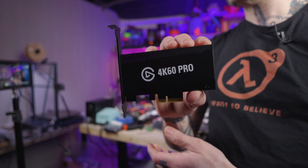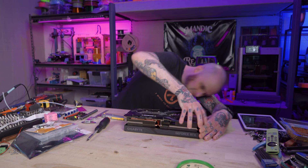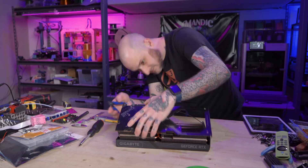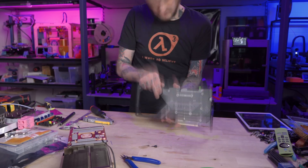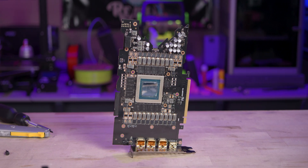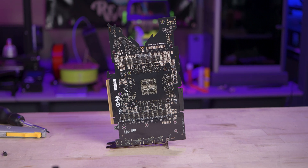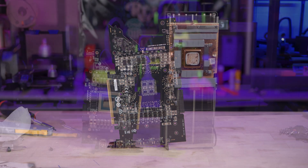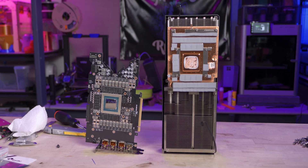I don't need those smaller slots, but I do need the 16X for my 4K60 Pro capture card. Disassembly of a graphics card is pretty much the same as disassembly of any other delicate electronic device — take out every screw you can see, pry a little bit to see what might still be holding, and be very careful of the small cable connectors. With the cooler off you can see the PCB and the components. There's so much crammed onto this board. It's very similar to the Nvidia card but not quite the same — that's why I had to get the specific block. And it is so much smaller than the cooler that comes on it. Video cards are just too damn big.